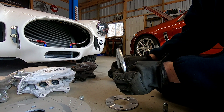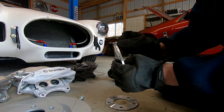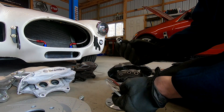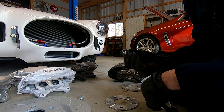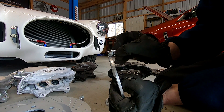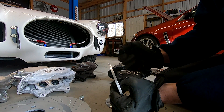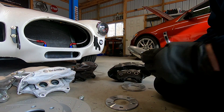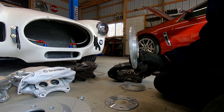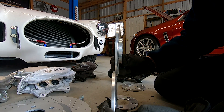Here's the same type of spacer but thicker — I believe this is a 6 or 10 millimeter. This is where I would recommend an ET lug nut. ET stands for extended thread. Even when you add a spacer and put this lug nut in, you'll actually get more thread grab on the lugs than you would with a regular lug nut.